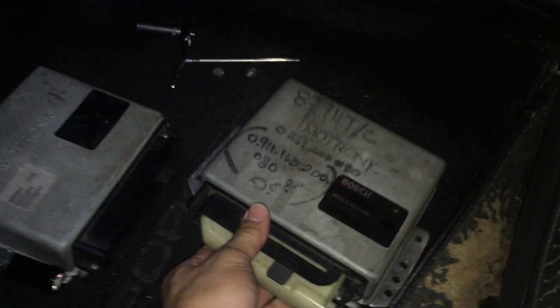I'm gonna go ahead and tap on the DME for you — two inches up: one, two, three. No change. And I'll use the top of my hand: one, two, three. Doing everything I can to make it fail. It's not failing.